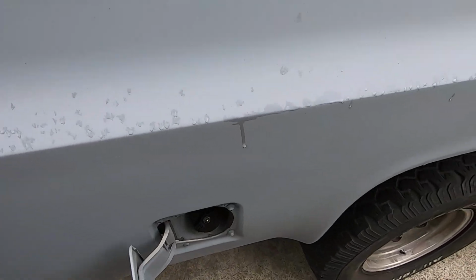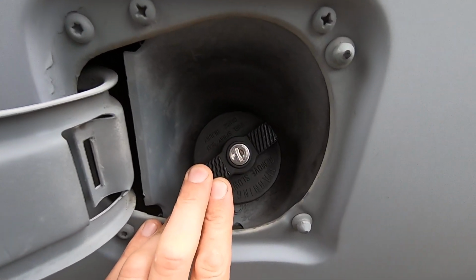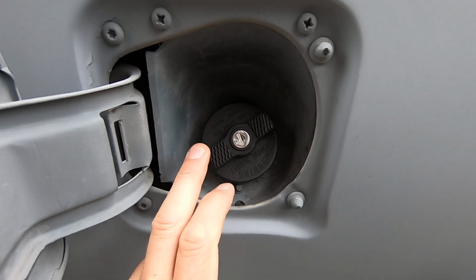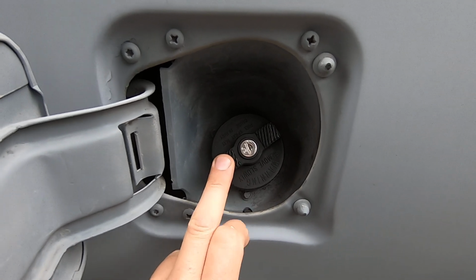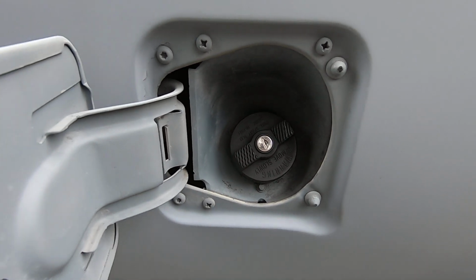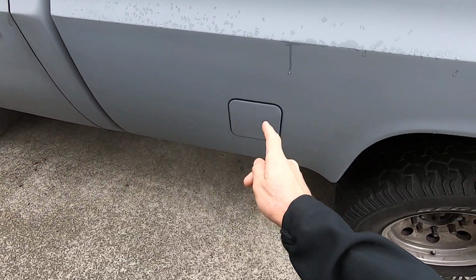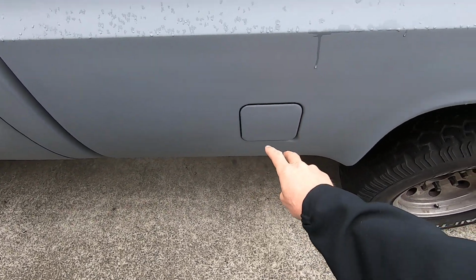Sorry, video. I had old gas caps on here and they were loose and they were crap. And so they weren't sealing, and I think some air was getting down, and when air hits that, especially here in Oregon, when you get that wet air hitting that ethanol gas, I think it was causing it to gel a bit, and then it was getting up in the carburetor and just plugging it up. So I drained the tank. I obviously put Seafoam in it, fuel additive, got all the bad gas out.